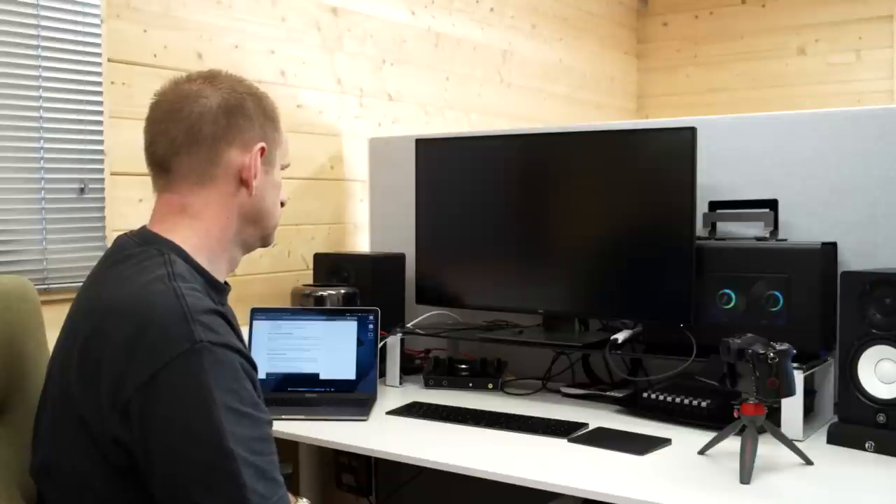It's a big outlay, so you need to weigh up all these factors. But we have answered the key question: yes, it is possible to use an eGPU with a 2013 Mac Pro or any Thunderbolt 2-equipped Mac, and it's not difficult to do. However, the implementation with the Mac Pro running Catalina is flaky — you will get occasional system crashes. I had two or three crashes today while playing with this. Once it's running and you're actually using it, it seems pretty stable. My recommendation for the 2013 Mac Pro: if you don't need Catalina, stick with Mojave — it seems to have fewer of these issues.